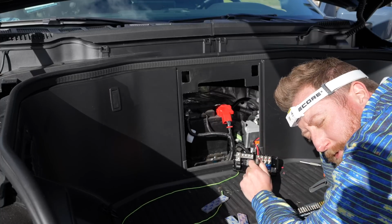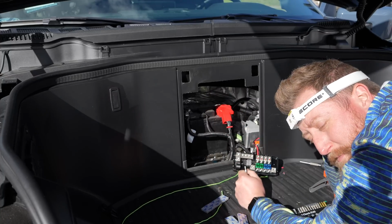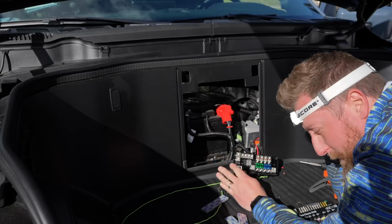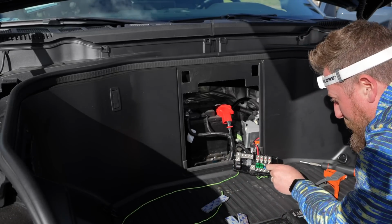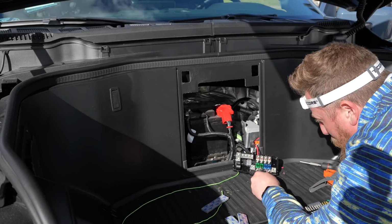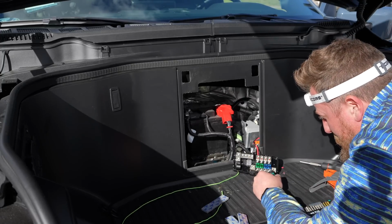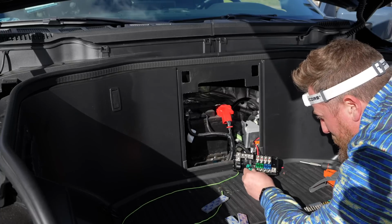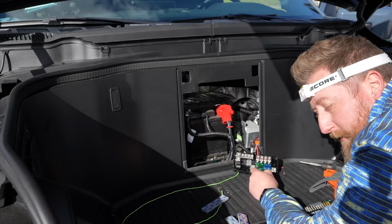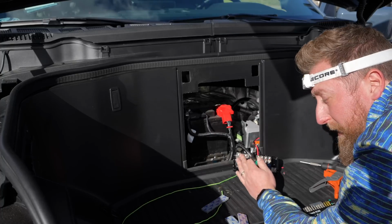Why am I mounting the distro box right by the power? Well, glad you asked. If there's a failure point, we want that fuse to pop immediately. And FYI, these are 30 amp fuses, both right here. This kit also has 60 amp, and I think these are 80 amp. Regardless, I'm gonna get some more 30 amps just so I have a bank of at least 4, which I probably won't ever use.